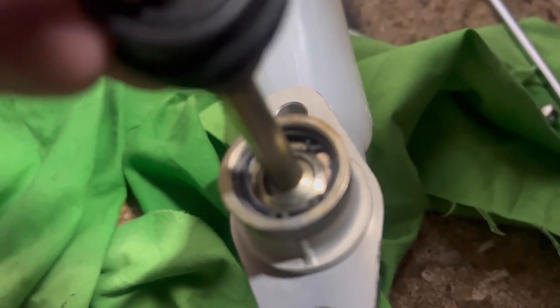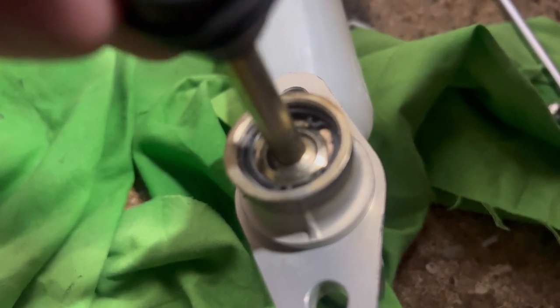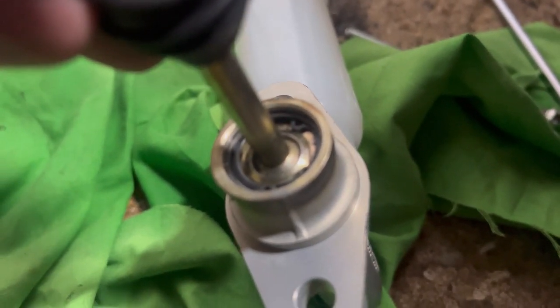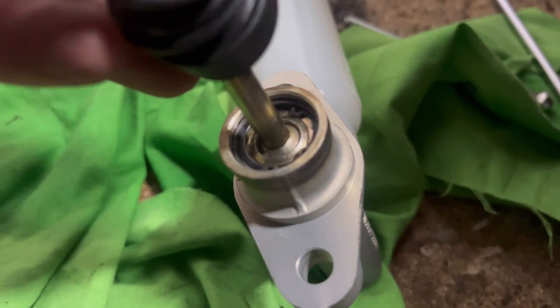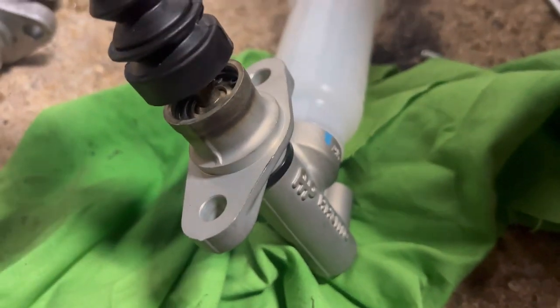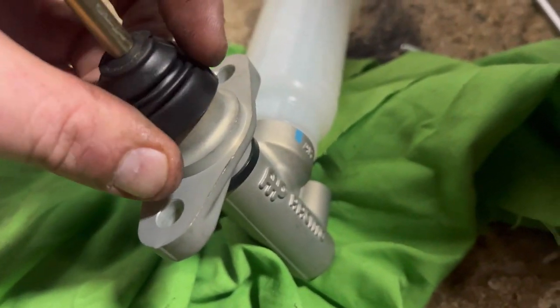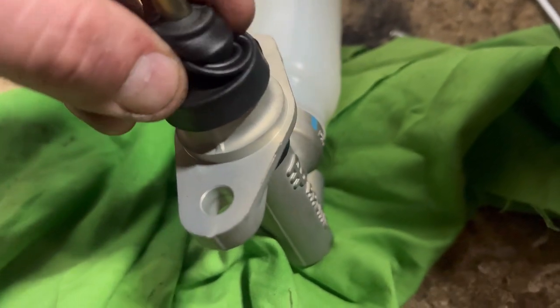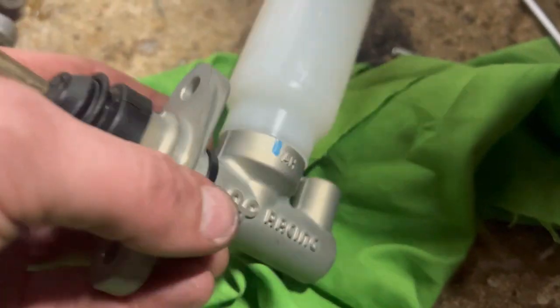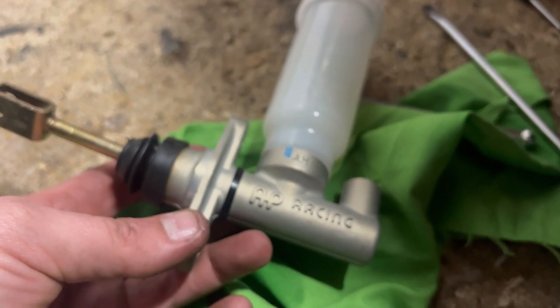Put the circlips underneath one another, so it effectively widens the washer and is held in by the top one, which spins freely in the groove as it should. If anyone thinks this is a really bad idea, shout. The video will be out long before I drive a thing on the road, so if I've done something stupid, let me know. It feels like it's stupid, but logic dictates it'll work fine. That's not an issue. Right, see how we get on.